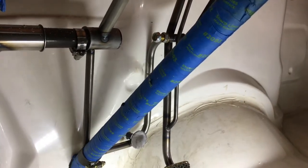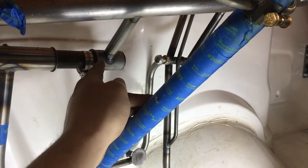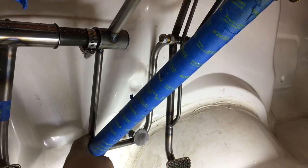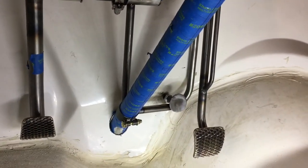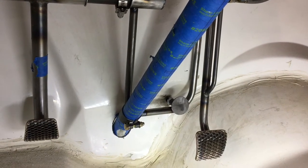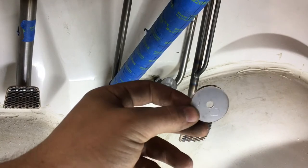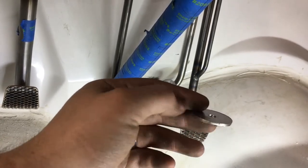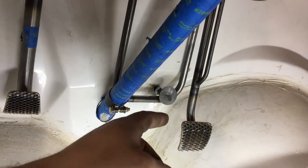Inside the Jeep now - we've got our brace in right here. We've already got our pedals braced and then we went ahead and braced right off of that as well to tie everything in together. Something else we built that I didn't film but want to explain is this throttle stop back here. It's real loose right now while we've been adjusting it. Basically you take a washer - I always keep my hole saw donuts, that's what I call them - they come in really handy for different things, and in this case they work great for this.